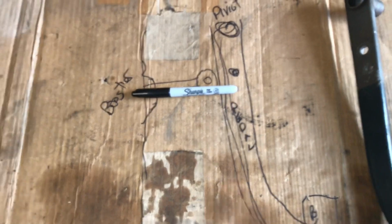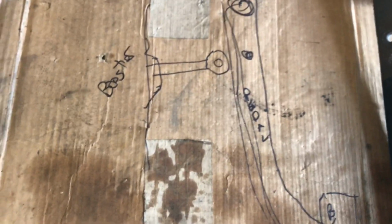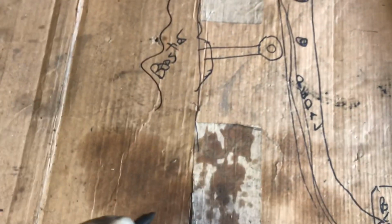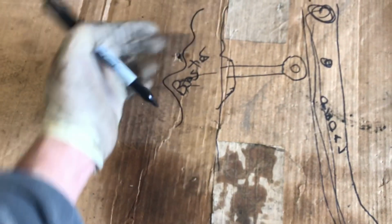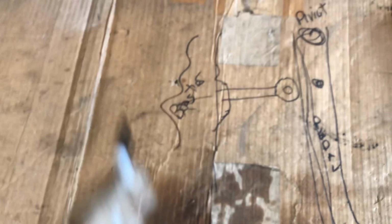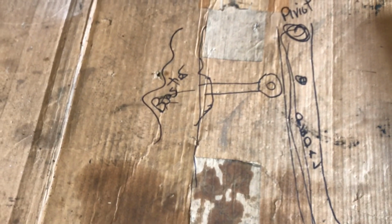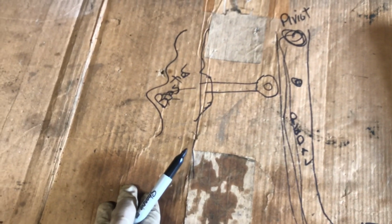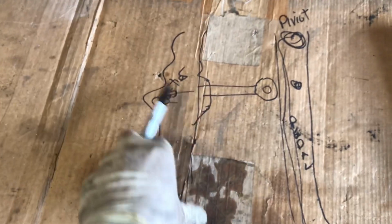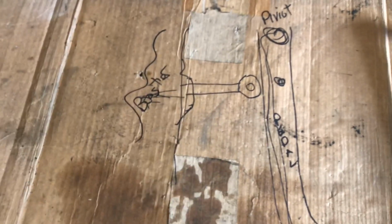I could not bleed the brakes. Because for whatever reason, this was going in probably at an angle. And a booster is just a diaphragm in there. So maybe it was compressing just the bottom of the diaphragm. And that was only activating my front brakes or just giving me weak pressure altogether. But it acted like a bad master cylinder, bad air in the lines. It was crazy. You couldn't hear a vacuum leak. So that's the only thing I can think of. It was just compressing the diaphragm at an angle.